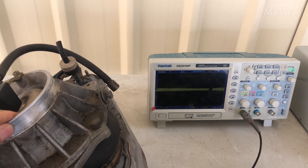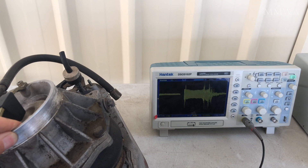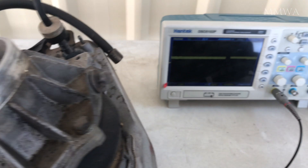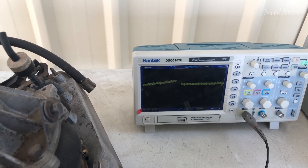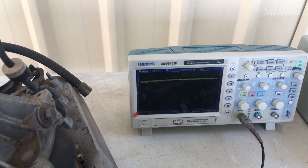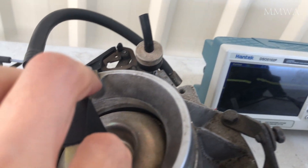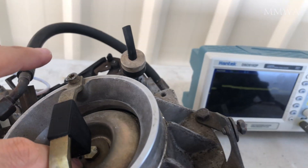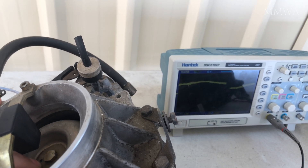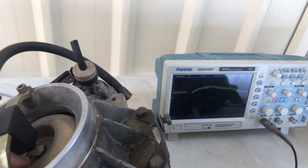For comparison, this is the one that was fitted to the car and it did run the engine. It is most atrocious of all just off the off position, but that's not really such a big deal — it's quite okay in the running area and the idle position. However, this airflow meter is also a piece of junk because it doesn't move very smoothly anyway. I'm going to have to make one out of the two. This is probably all gummed up inside, but I'm not sure I'm going to use either of them at this stage. I certainly will be getting new potentiometers regardless.